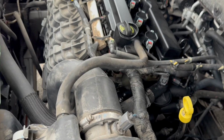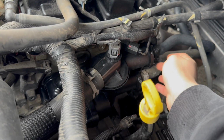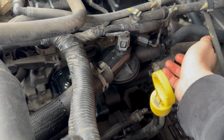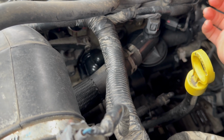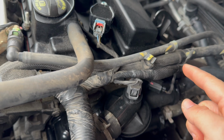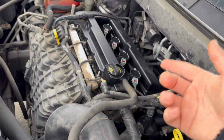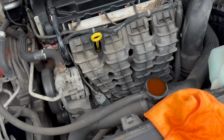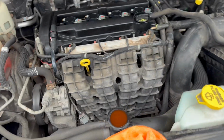And by the way, I'm not sure if I mentioned this or not, but the reason I had to bleed the coolant in the first place, which was about a week ago, is because one of the hoses on the thermostat exploded and it melted off the piece on the thermostat that goes inside the hose. So I had to replace the thermostat because I didn't know about this until the car overheated, and it overheated because a bunch of coolant fell out of the hose, which made that mess. And not only that, I found out the valve covers were leaking, so I also had to change the valve gaskets. And then because I did that, I'm like, all right, might as well change spark plugs and coil packs. So that's exactly what I did, and now I'm here, but the car's running fine. Everything seems good. I see little to no air bubbles coming out, so we pretty much already bled all of it. So we just gotta do the finishing touches.